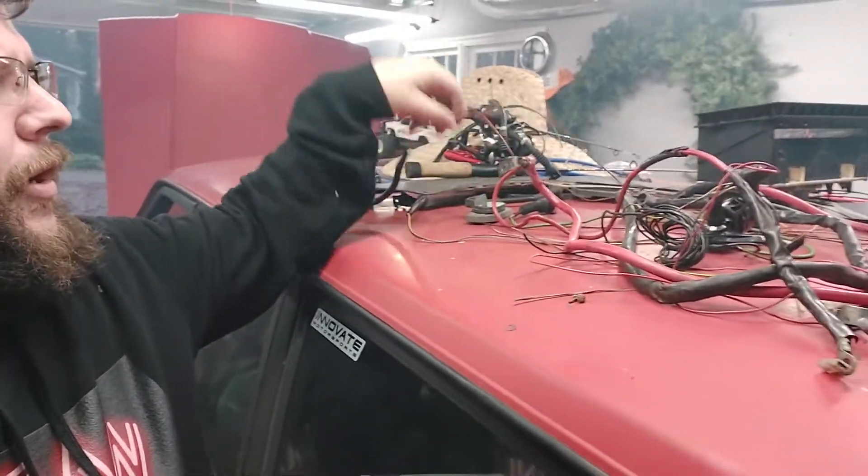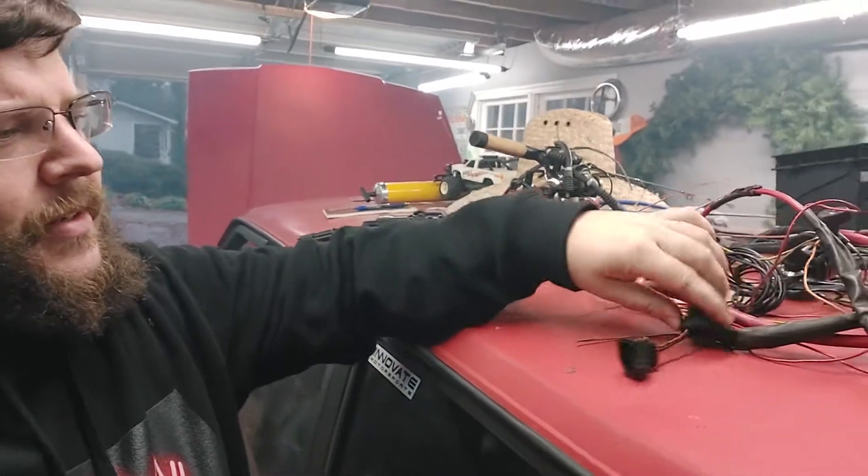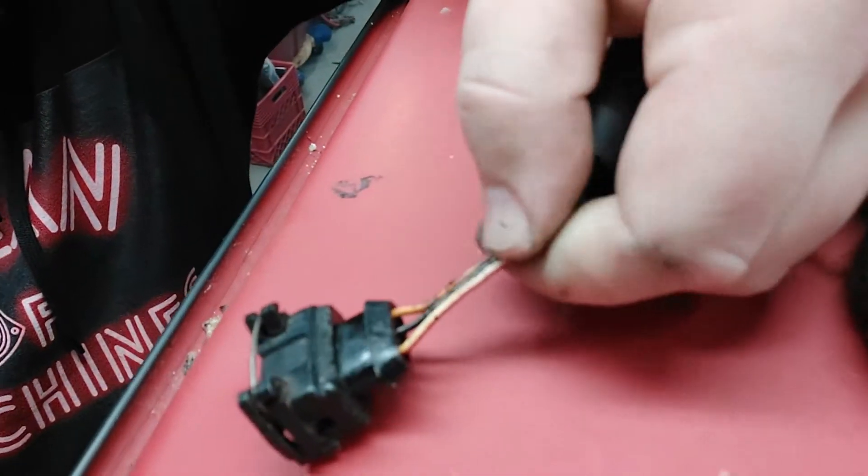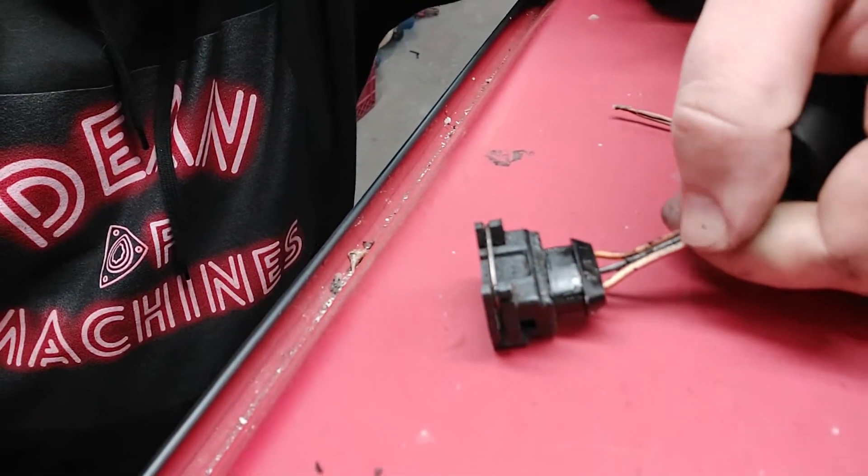Now it might be a surprise to you, but I have figured out that my crank signal had something to do with wiring. The crank signal actually works off a three-wire plug. I figured I would be smart and just use the old plugs from the old wiring harness — I have piles and piles of wiring plugs to mess around with. Typical three-wire plug: the ground is the middle wire. I used a plug where the ground was the middle wire and just color-matched, because that's how things go. I couldn't get confirmation as to what goes where, but after some to-do I figured it out.